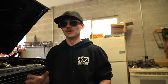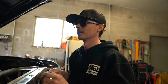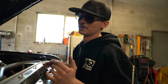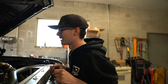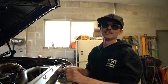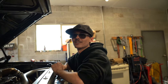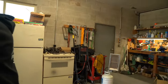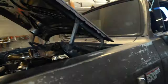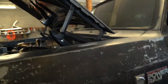So ultimately his line pressure is running kind of low. We're gonna see if we can turn it up to counteract whatever has most likely gone wrong in the transmission. It's not necessarily the happiest, but it's an easy way to check it. I think line pressure is at 90 typically. Yeah, around 150 is where we'd like to see it. So we're a little low. We're gonna drain fluid real quick, probably adjust and fill it back up, and then we'll catch up with you guys on the next test drive.